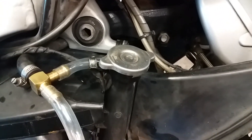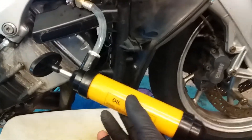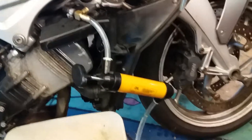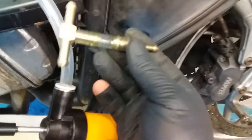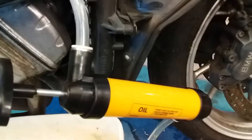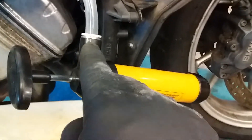These pumps are only cheap — they come with a metre of hose. I think I paid 15 bucks for this. I had my mate Saidji over here with his vacuum gauges and we actually teed off this pump with a reducer down to his gauges, and it worked — it held vacuum. Took about 10 to 15 pumps. This is the suction side and I've got the dump side going to a rubbish bucket.